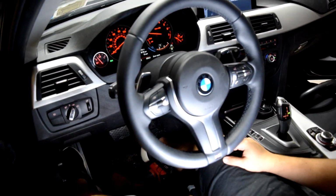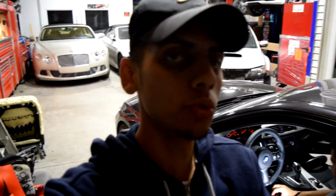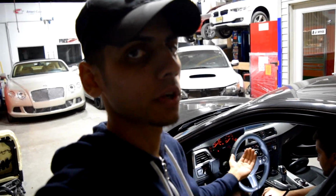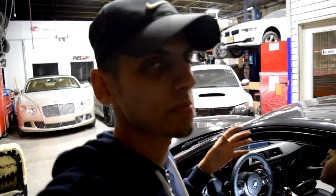It looks amazing. Can you lower it to the settings I have it at? Make sure that you move the wheel out all the way and up all the way so you have enough clearance to stick the flathead screwdriver up the little hole of the old steering wheel. It just makes everything easier. Don't do it in your desired driving setting, because that's not how you're supposed to do it.